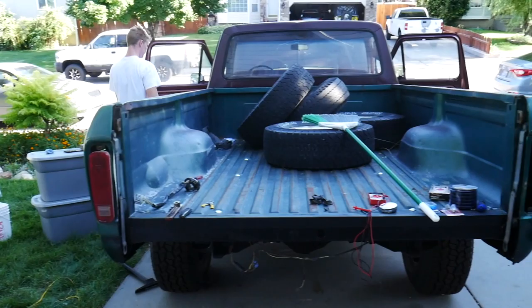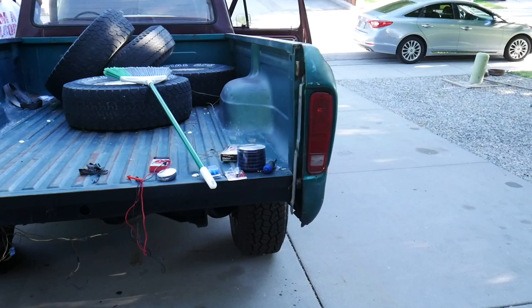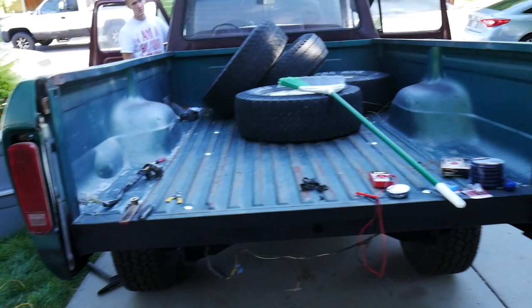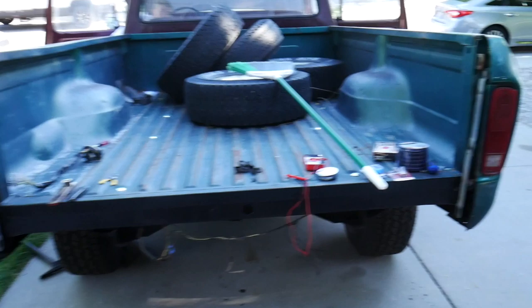Tavish is going to do some light finagling for us. Put that back in. Do a turn signal to the left — we have a turn signal to the left. Do to the right — it's dim, and that's what we're troubleshooting next. That one's just not getting full power for some reason. I think the bulb might be in wrong and backwards. Hit the brake pedal — we have brake light, real strong on this side, dim on this side again. Okay, that's good.